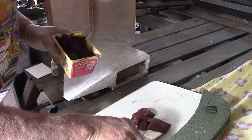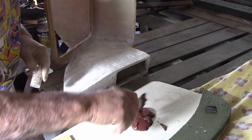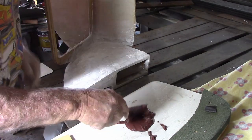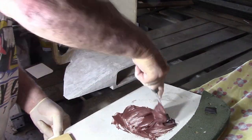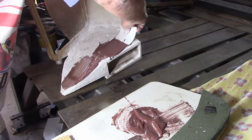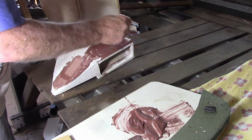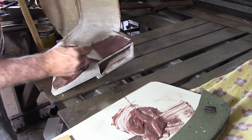I do a lot of this in the fiberglassing - I'm about to bog up the low spots. I don't have to do it at this stage, it's just a matter of when it's convenient. I've got a fairly loose bog here, I'm going to catalyze it as a fairly hot one. Once it's mixed enough, get it on and spread it out, making sure you get all the low spots covered so that you can sand it back and end up with a nice smooth job ready to paint, whether you use flow coat or gel coat.